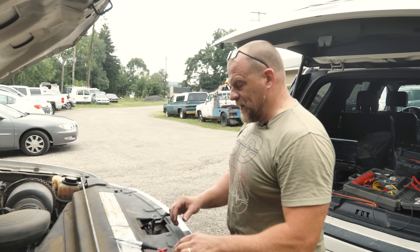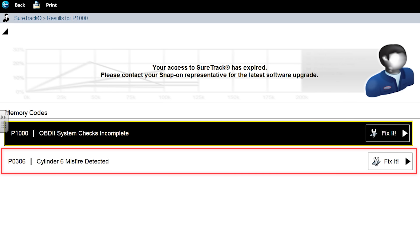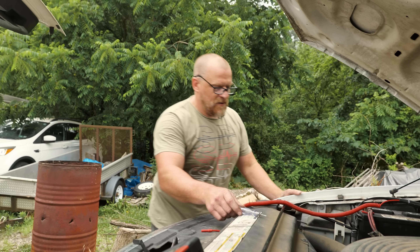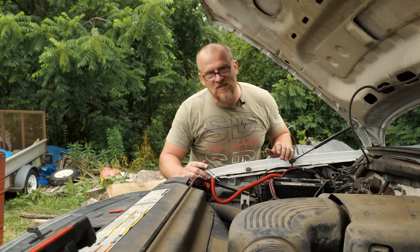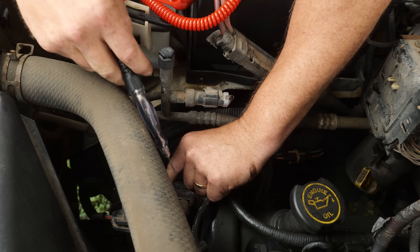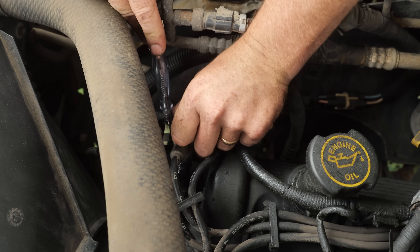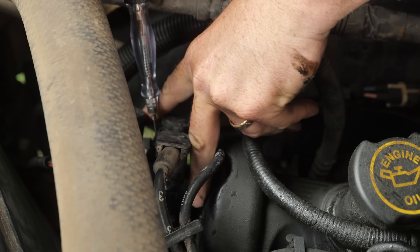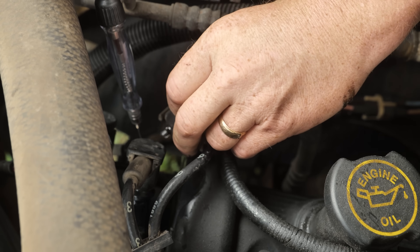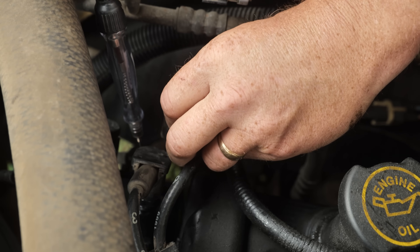We should probably at least look at the codes first. So under six — cylinder six is over here. Let's see if we got spark on cylinder six. These ones make me nervous because they got these little locks. Got to keep my test light closer than my finger so I don't get bit. Lots of spark, no RPM change though.